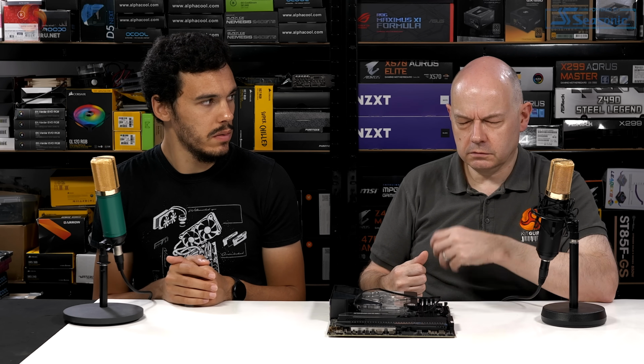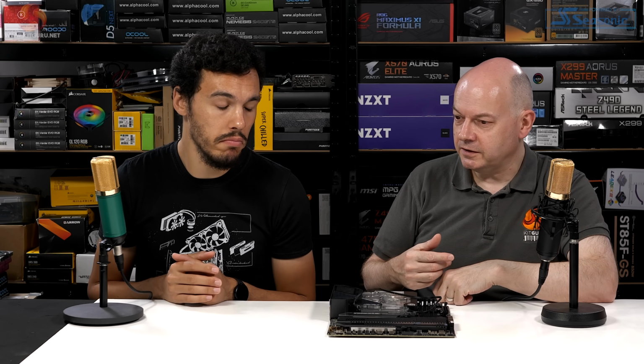So when someone says, yeah, I put 500 watts through a 280, I'm like, huh? But then you go back to that and you think, yeah, okay, fair enough. People often say the rule of thumb is you need a 120mm unit plus a 120mm unit for each other thing, which typically means CPU or GPU. So really what they're saying is a 240 for your CPU, a 360 for CPU and GPU, which is frankly nonsense, because this is going back to before these parts drew so much juice. And we've got rumours of AMD processors coming up with 175 watt TDP, I think. Stepping up, I think, is the thing, some beefy ones.